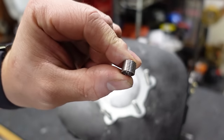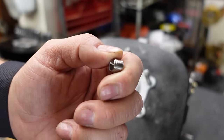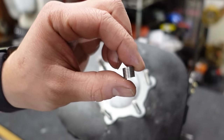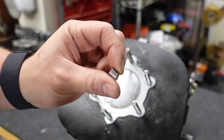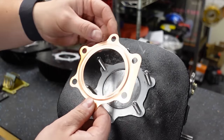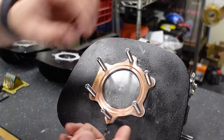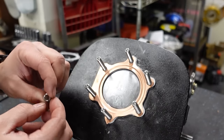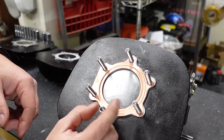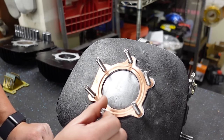So the first fix we're going to do utilizes helicoils. These are really cheap. You can order like 20 of these on Amazon for $5-6, shipped to your front door. This is an M10 by 1.25 or M8 by 1.25. I will have this listed in the description below. I'm just going to put the gasket in place to show you how this works. The gasket is on there, and then you take these, and these will thread right onto your cylinder studs. We're going to do one in the front and one in the back. That way it will center it up nicely.